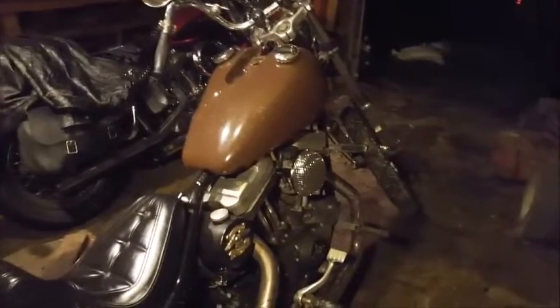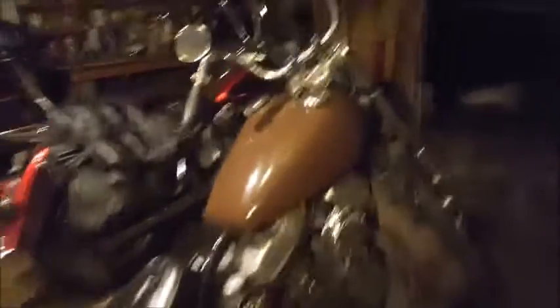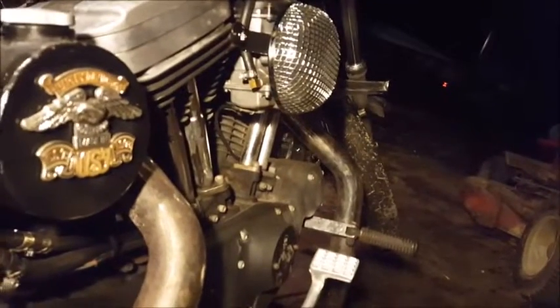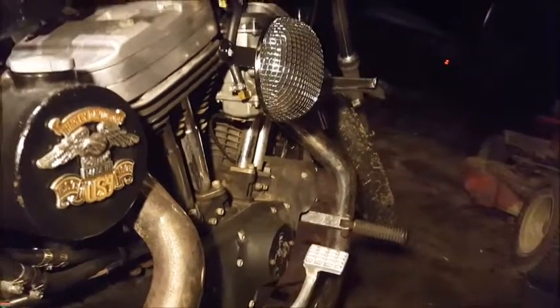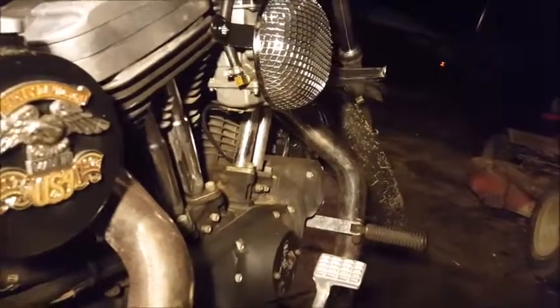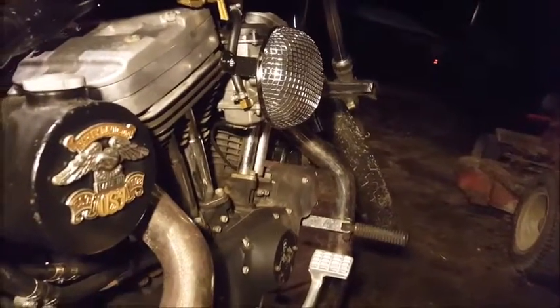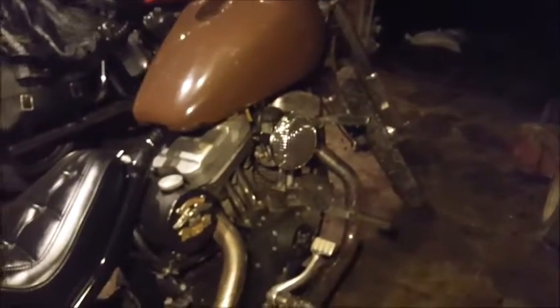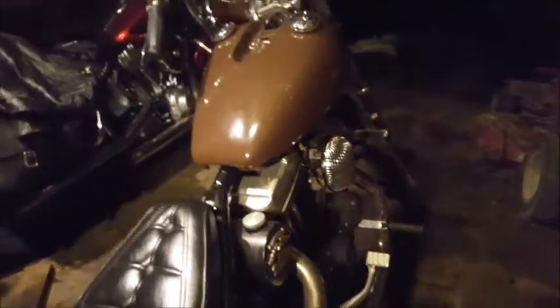Okay, I've got the gas tank on it and I changed out the jets. I put a few jets through there, tried different sizes — from a 42 to a 48 slow jet. I've got a 45 in it now. And I've tried a 165 to a 175 main jet on the carb, and I'm at a 170. So far it ought to sound okay. I ran it up and down the road already. Let me fire it back up and give you an idea of how it sounds.